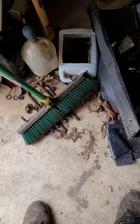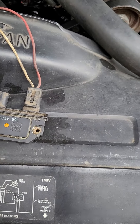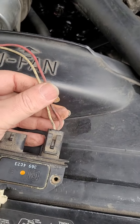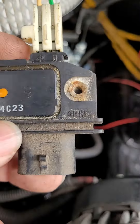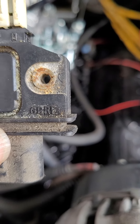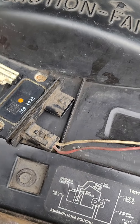Looking at wiring diagrams, there's actually a plug from the ignition control module — mounted underneath the distributor cap with the pickup coil. This is your four-pin wire. You've got G, B, R, and E on it. The R wire is your reference wire to the computer that tells it how many RPMs the engine is running.